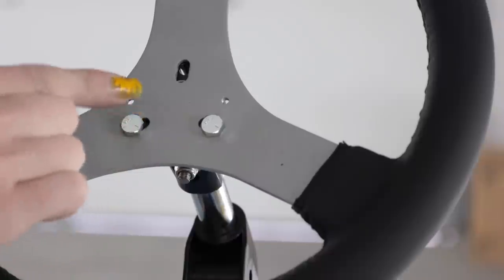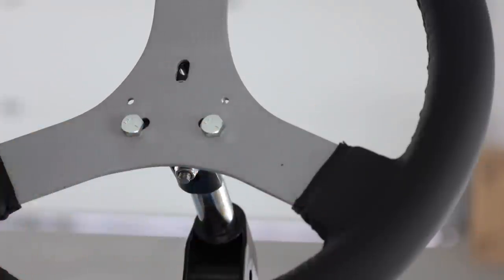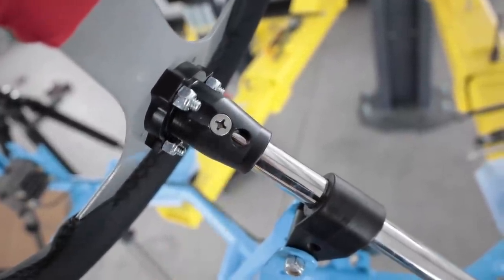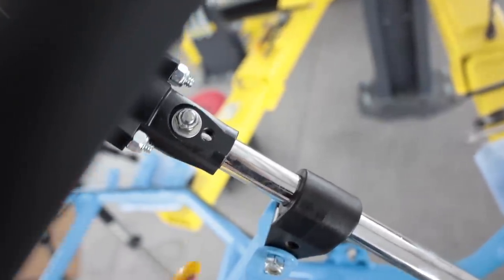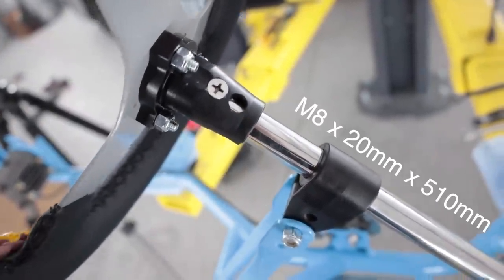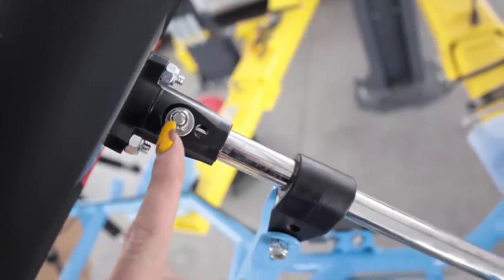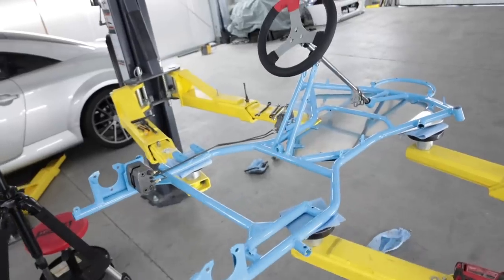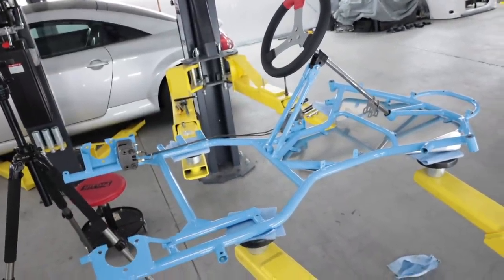I don't really like the hardware I have for this, so I'm probably gonna get some black anodized bolts so it all matches. But for now we'll just mount it up until I get the right bolt. Everything is good except for one issue — if you notice right here, the size of that hole versus down below, it's a smaller diameter hole. The shaft has this diameter hole, but because there's a small diameter hole down here I had to get a bolt that fit accordingly, which causes play in the shaft. So I think I'm gonna have to bore the hole out bigger and run a larger diameter bolt all the way through. That's why it's been taking me so long — I'm re-engineering the whole go-kart and buying new hardware for every single component because none of the hardware was correct.